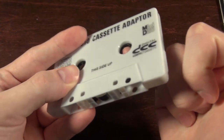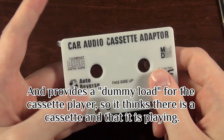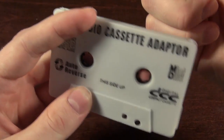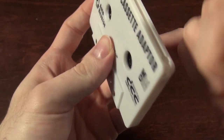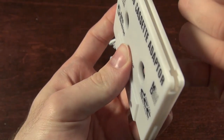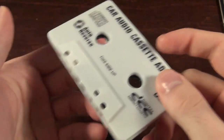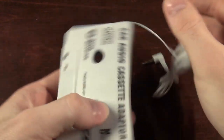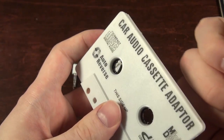It's got the usual gearing system in it so that it goes one direction. The auto reverse label actually applies because there is a braking mechanism — mainly it works sideways at the vertical. So it'll spin if it's upright, but when it's in a car stereo and it lays down, the braking does work for that.